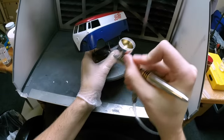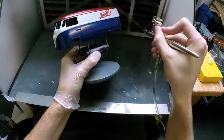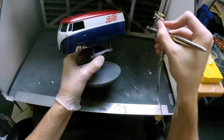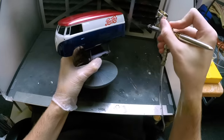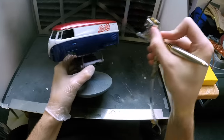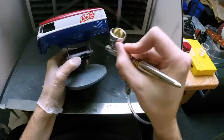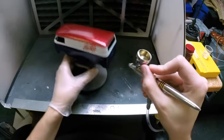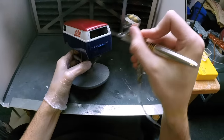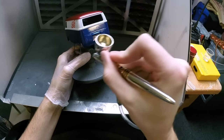With the panels on this body being so large, I like to pull the airbrush back a bit more than I usually do — just like on the color coats and primer coat — to get even coverage. Pull the fan all the way open with the maximum amount of clear coming out, but don't go too slow; move along quickly. Make an even coat — if you go too slow you will overload it and create runs. So be careful, pull it a little bit further away, and give it all you've got.